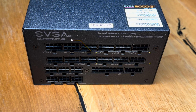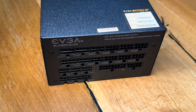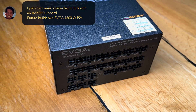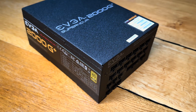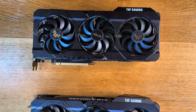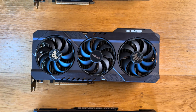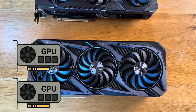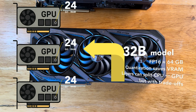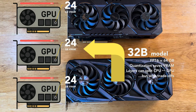With multiple GPUs, the power supply is one component not to skimp on — go as big as your case and budget allows. I picked a used EVGA 2000-watt unit, enough to run four GPUs. Data center GPUs are out of reach for most home users, so I went with gaming GPUs — in my case, used RTX 3090s. For my needs, the 3090's 24 GB of VRAM hits a sweet spot: big enough for large models at a reasonable price.